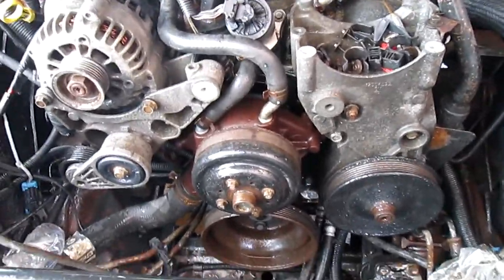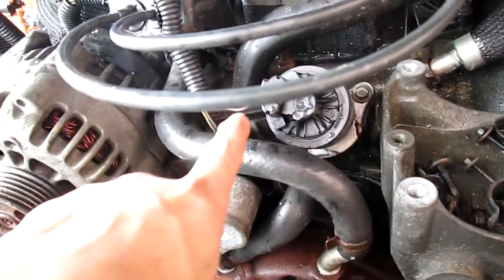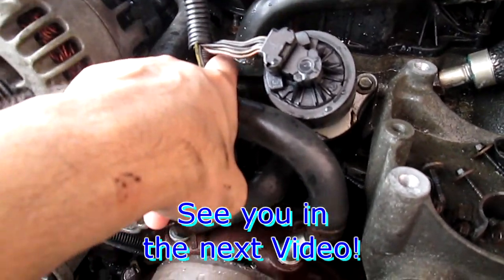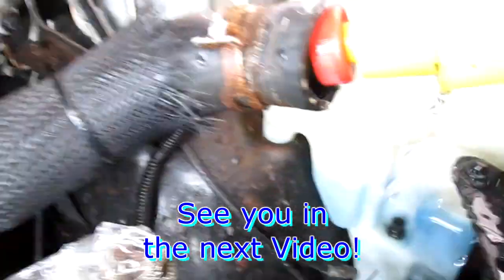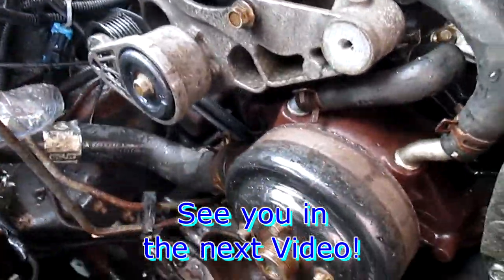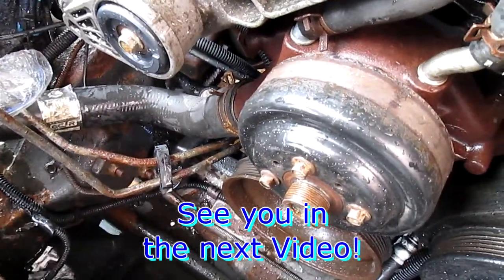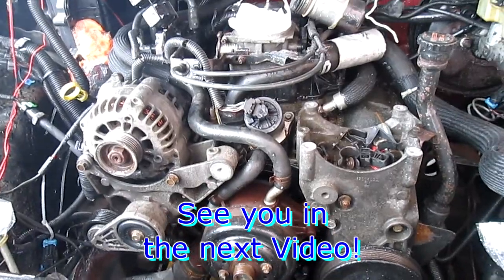I'm going to end the video. Now you know how to do it — just use that part right there and go through the system. Remember, you have to take the thermostat out because a normal thermostat opens at 195 degrees, and this water is nowhere near 195 degrees, so it won't flow with the thermostat in. Since it's all open now, you can just flow it easily. You can also go from the other end — you'd have to block it to force the water out from that end. You can figure that one out.